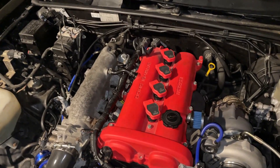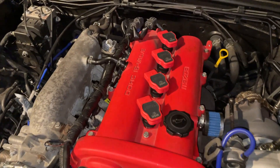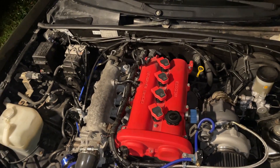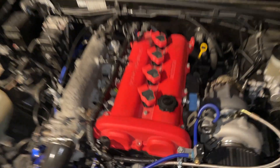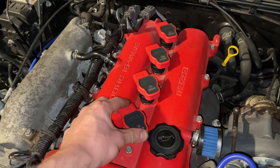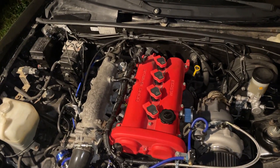In today's video I'm going to get rid of these old coils. I got some Audi R8 coils — this will give a lot stronger spark. It has a coil for every single spark plug. In the old setup it had two coils for four spark plugs, and now it has one for each. I also gapped the spark plugs to 0.8 millimeters.